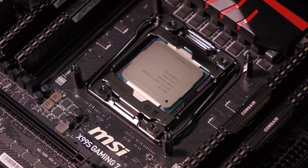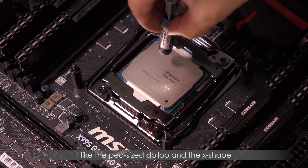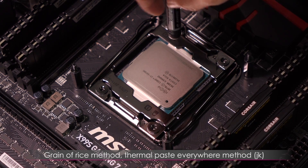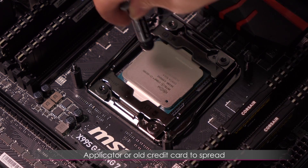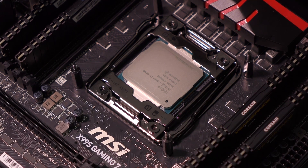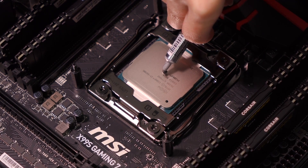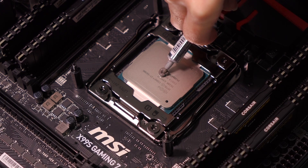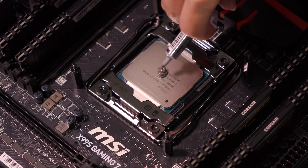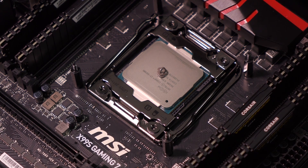There's a variety of ways you can apply thermal paste. The two best I find are just a pea-sized dab in the middle or an X shape, but you could also do a line. You can use the applicator to spread it, but like I said, air bubbles are a concern. I'm going to go ahead and uncap this and start applying — just a pea-sized blob in the center. There's a multitude of ways people do this, but I think this is good.